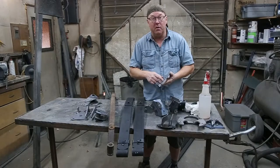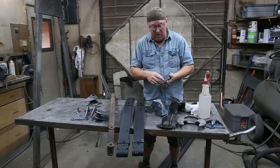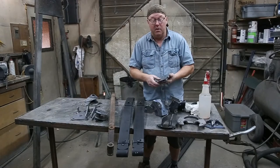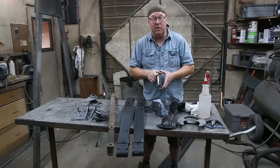That's because this is a prep problem. This chunk here is made out of some really good steel — it looks like cold roll — and it's really quite shiny. You put a coat of paint on that, it's not going to adhere very well.